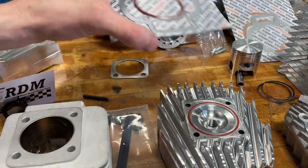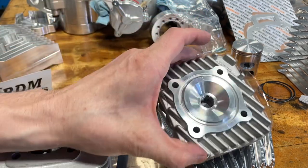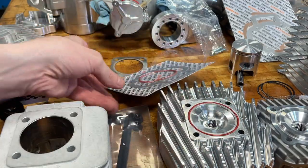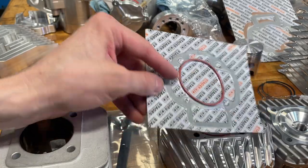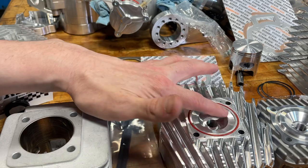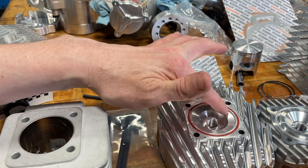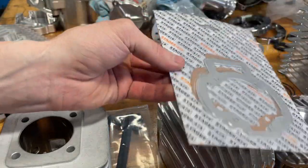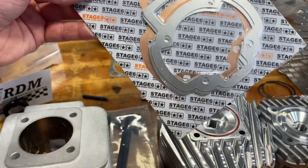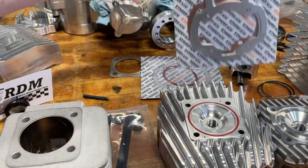This little red O-ring is the exact ring that would be used with the stock Piaggio head — I replicated this groove exactly, very close tolerance, into this head. Therefore, we use the stock base gasket and the stock O-ring, which is included with these kits. This squish gap here is critical. I would run it anywhere from maybe 0.6 millimeter if you're extreme, up to maybe 1.8 — almost 2 millimeter. You need to get the Stage 6 Piaggio gaskets because the Stage 6 Piaggio has actually extra-large ports, and a lot of other gaskets just barely seal this rim, since we use a very extreme top end.